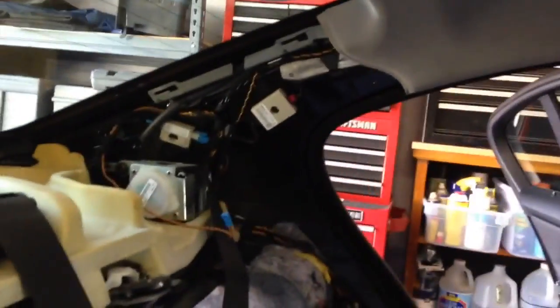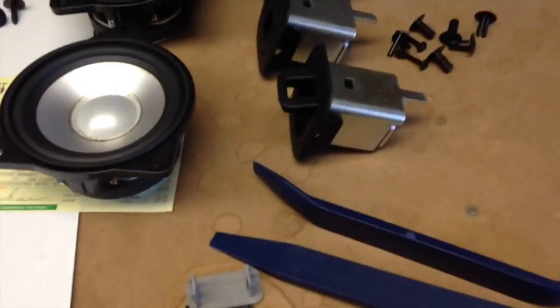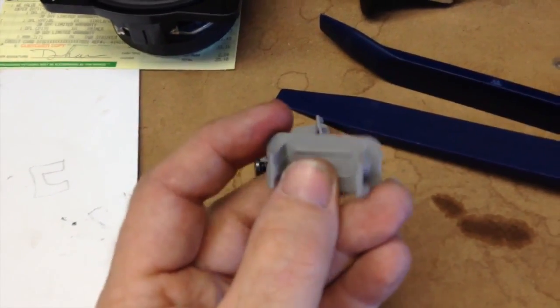The next thing is the rear wing panel - the gray piece normally goes right in there. There's a little plug in each one of them that says 'airbag' on it, which is a little terrifying, but actually it's not. You pop that out, take the screw out, and then pull the front edge of this panel out. You can see there are two slots here - you just grab the panel, pull it toward the front of the car, and those two little tabs slide out. Both wings come out.